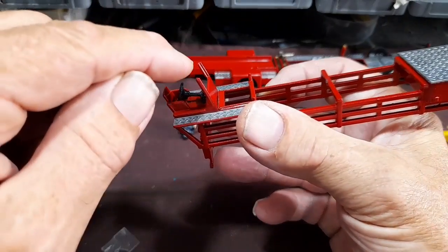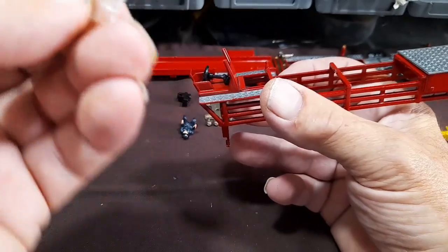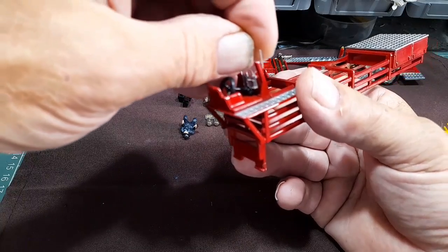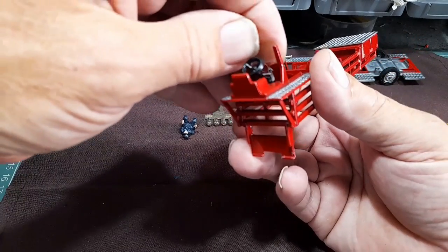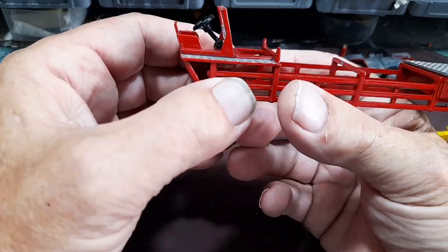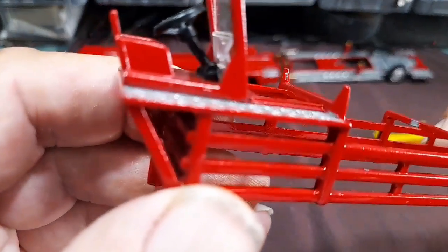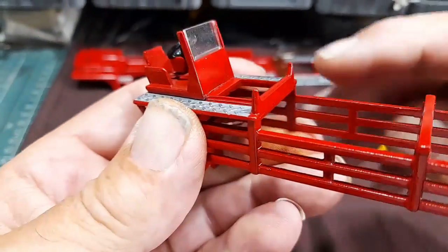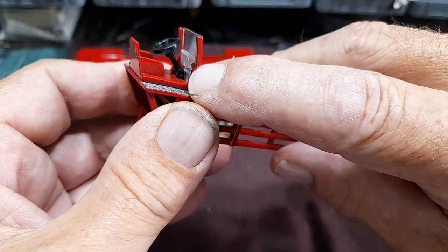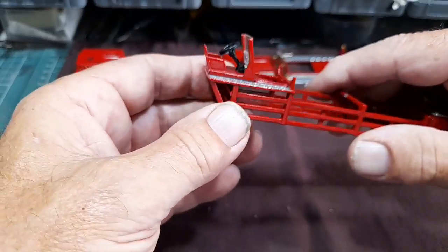Like I say, this is a fiddly bit. Now, if you see on the outside of your window, you've got a little rebate where your fat lug at the bottom goes on the inside against the steering box, and the glass goes on the rebate. That's how it goes, and then it pushes down and pushes it together like so. So you end up there like that. You've got your rebates on the outside of your glass. The large piece of glass that sticks out goes in between the steering box and the metal. You push it down and it brings it like that.